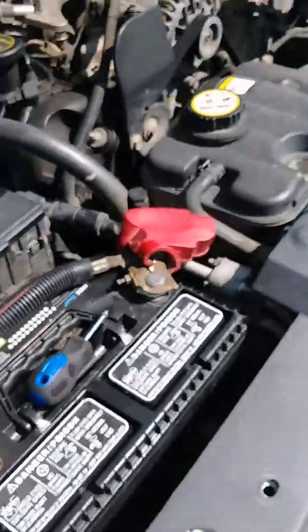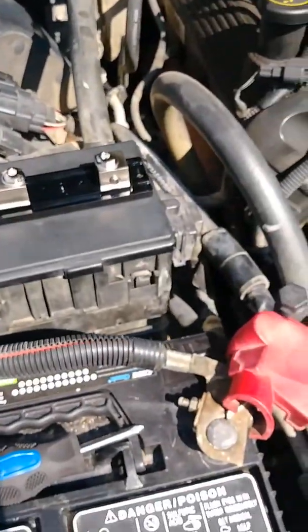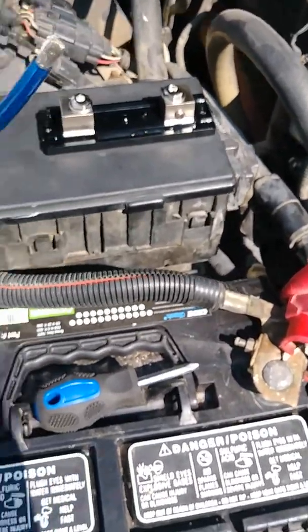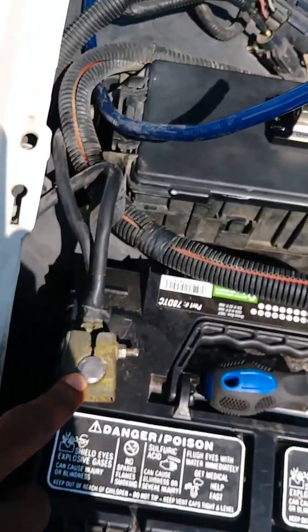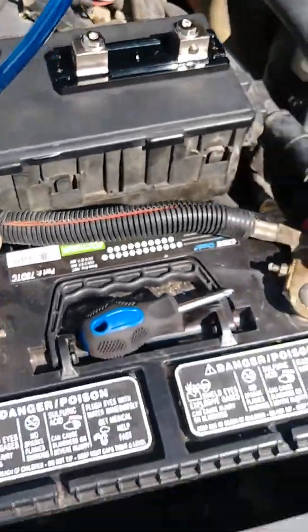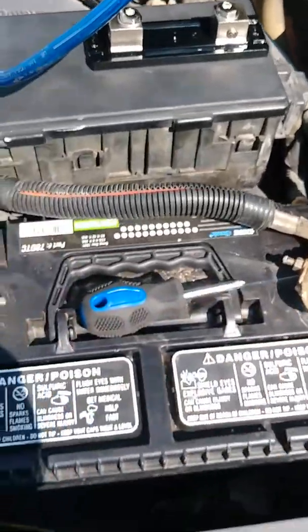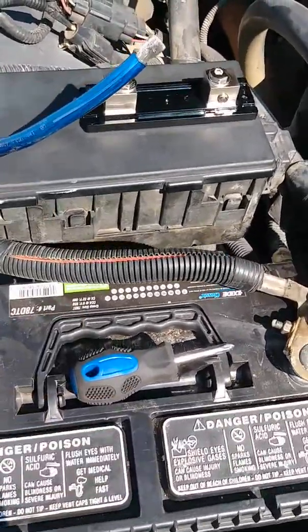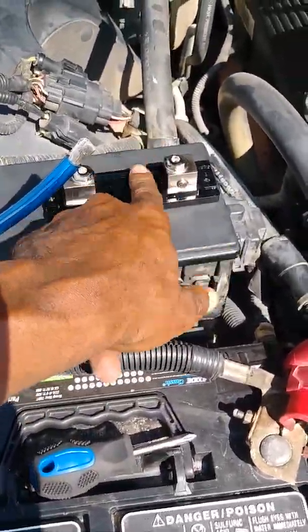There are plenty of ways to run your wires and hook this stuff up, but it's good to have things pre-placed like this. If you're going to be powering everything up the same day, go ahead and take the negative cable off. Since I'm staging where I want everything, that's the only reason I still have both cables on — because I'm not throwing any power to it. And even if you are, have your fuse out of your fuse block.